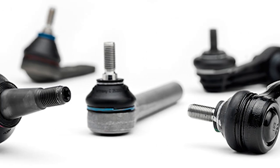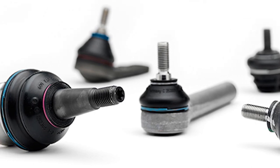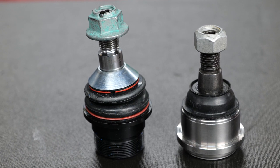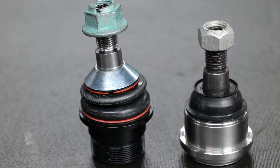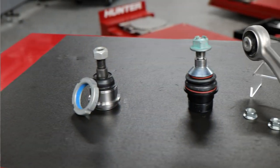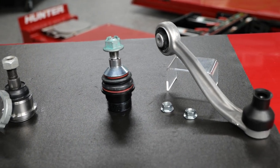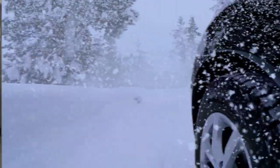today's state-of-the-art high-performance tie rod and ball joint programs put original equipment quality into the aftermarket's hands. For example, TRW ball joints feature an outer housing that's manufactured using forged or cold-form steel for additional strength and reliability under the harshest conditions. On the inside, the full ball metal stud is made of either stainless steel, geomet, or similar metal coated for corrosion-free performance.